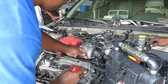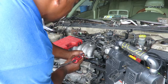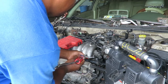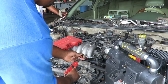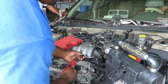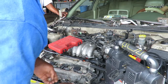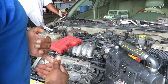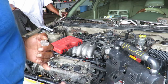Put the key in the on position. Don't crank it, just put the key in the on position. Now crank it. Alright, so the computer is not working. Not good. So now we're going to figure out what's going on with the computer. We're going to pull up the wiring diagram and check the power, the fuses, and everything going to the computer.